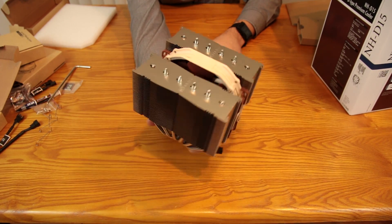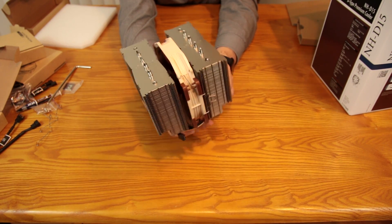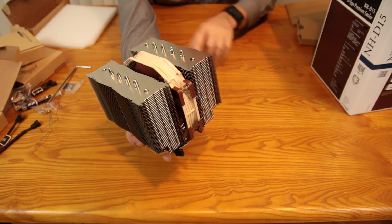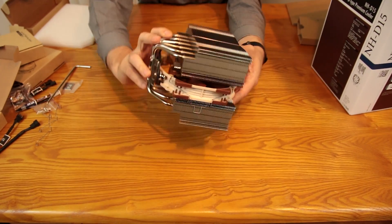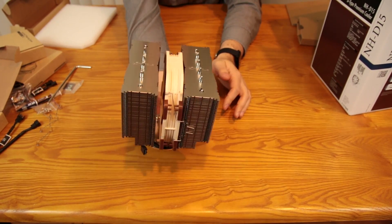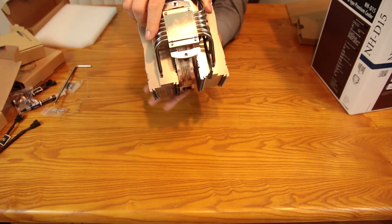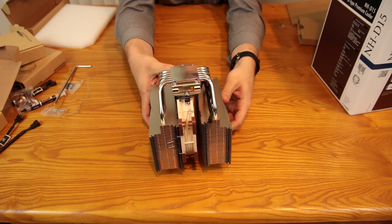The fins are actually a little bit tapered on the edge — they stick out a little bit more at the ends than in the center. The thin fin design is nice and packed in there. You can see all of your heat pipes — six heat pipes running off of the actual main block on the bottom. Those little clips are what mount the fan onto the cooler. One of the things they've done here is add little indents on both sides to make some clearance room for your memory.